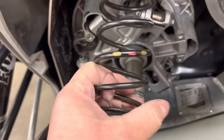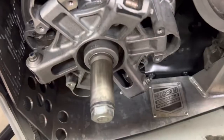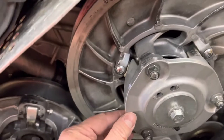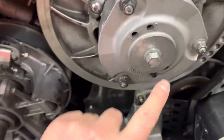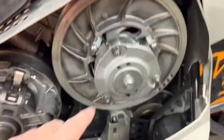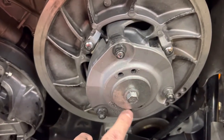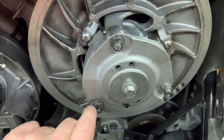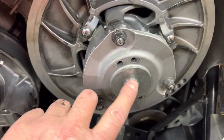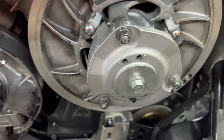I'll button that back up. I've got the stock yellow-red-yellow spring, and I looked up the specs on my Yamaha service manual that I got from ty4stroke.com. You can get the position — I put my secondary back into 3-3. On the Sidewinder, this big washer holds this in, so you can actually take these out and then loosen this slowly, and the helix or the spring will push this out.